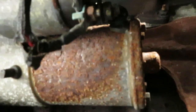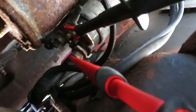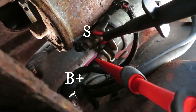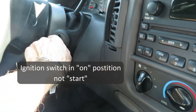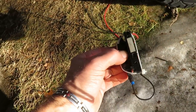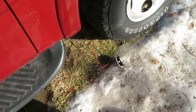Now let's say you have a vehicle such as this F-150 that won't start. Determine the battery's good, starter's good — let's get it going anyway. So now we've hooked up one lead of our remote start on the battery plus and the other lead on the S terminal to the solenoid. Turn the ignition on but not start. With a problem in the ignition switch or wiring, this could get you going.